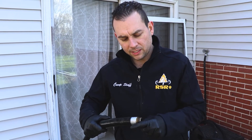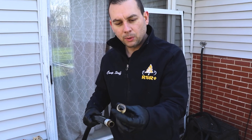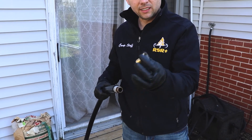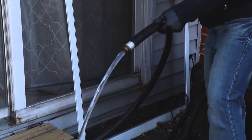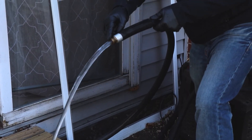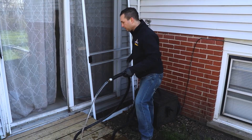A quick tip on connecting your hose to your pressure washer: you want to make sure you run your hose and get all the air out of the line before you connect it to your pressure washer. Also, make sure there's no debris blocking the threads. If you have a quick connect on the pressure washer, you want to take that off unless you already have it attached to your hose. Make sure there's no air in your garden hose and that it's running without spurting — this is perfect.